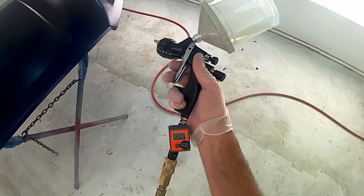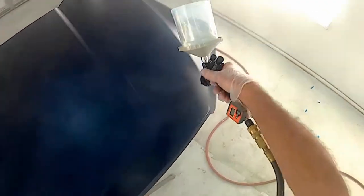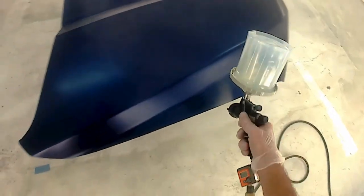Just messing around since I've got plenty of leftover materials. That blue is made by De Beers — I've never sprayed that stuff before, it was given to me. I don't know how old it is, it's pretty old. So I'm going to apply some intercoat clear now. Since I'm doing some graphics, that'll create a barrier between the base coat and the graphics and the clear coat, and you'll have quite a bit of time to do your graphics without having to worry about a recoat window for the base coat, which is generally 8 to 24 hours.